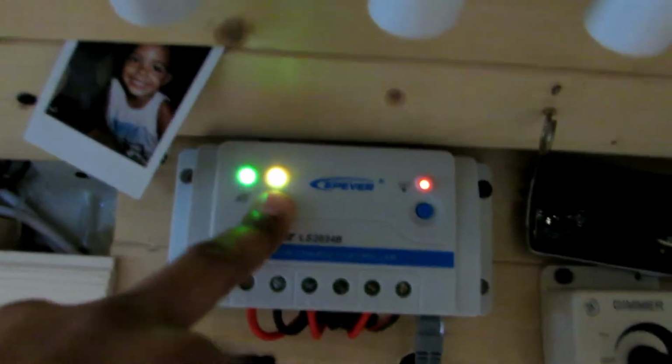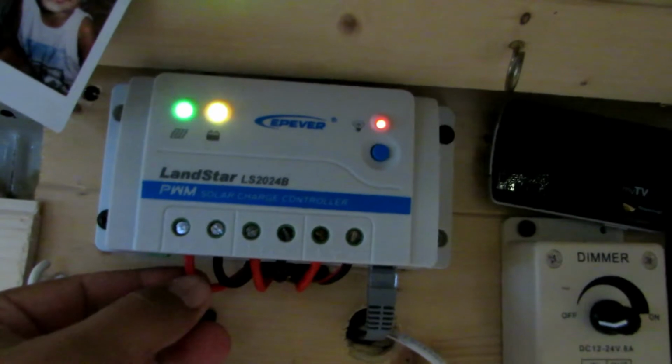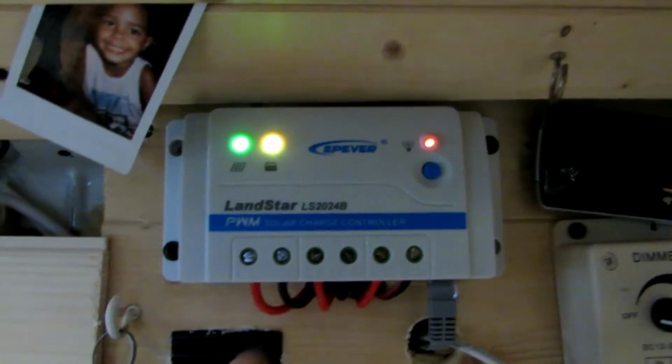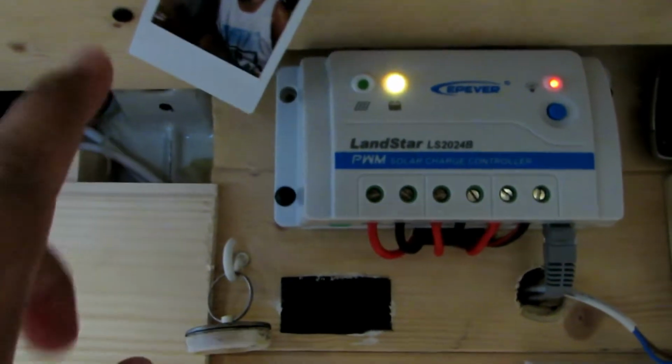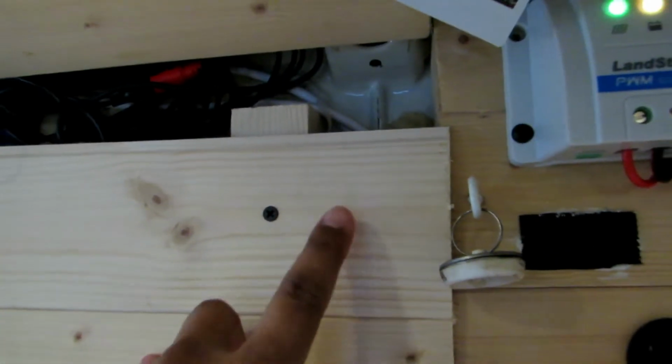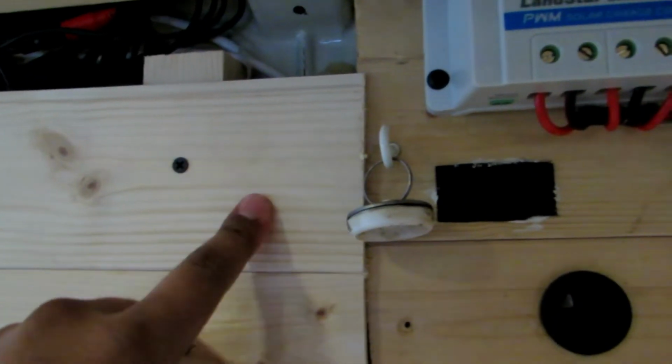So what I'm going to do, I'm going to bridge the solar with 2 clips here, so going into here and then going into my next controller, and then this controller will be charging this device, because remember the charge rate on this is quicker than the acid. And then obviously the controller, what I like about the controller I'm getting, you have to switch it on and off.